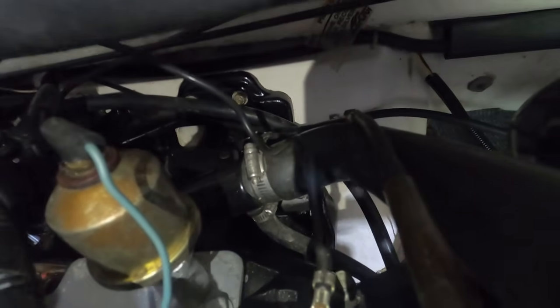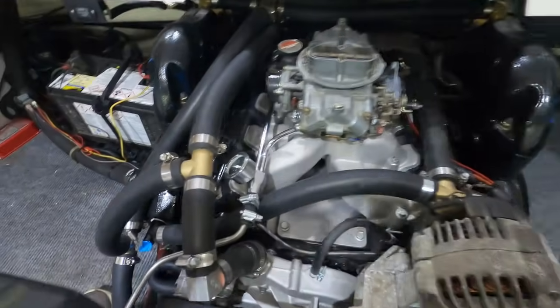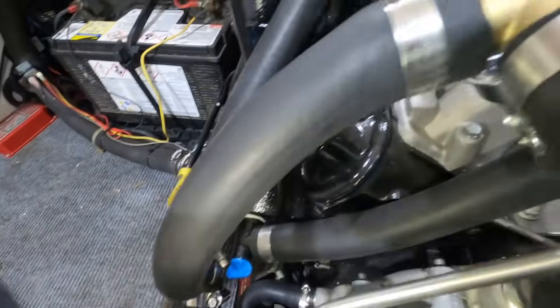Now my water routing, I don't know if you can see, that clamp right there comes directly out from the Alpha, pumps water up. I got a T here, feeds this manifold there, feeds that manifold there. Then the water runs through the manifolds into the risers, comes up to this T, runs down and feeds the thermostat. As that line fills up, there's also a bypass line here that I put in to feed the outlet side of the risers. That's the second one, the furthest fitting away from us. And then it's teed off and obviously feeds that one too.